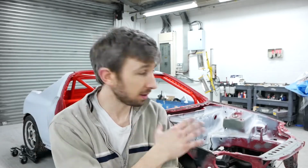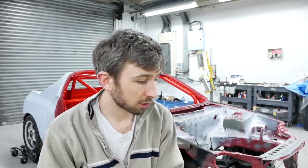It was basically through some wet on wet primer, which is prime, flash off, and then on with the base, and then a lacquer coat on top. So three separate stages in the booth. The wet on wet primer went on absolutely fine. Bit of an issue with the base. It did start to react and pickle up in a few places, as you might have gathered. Again, I think that's probably down to me buying a cheap paint.